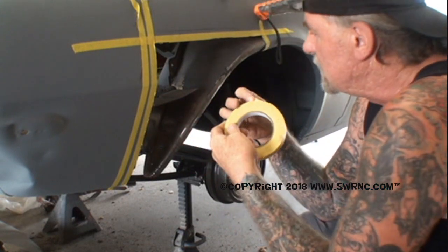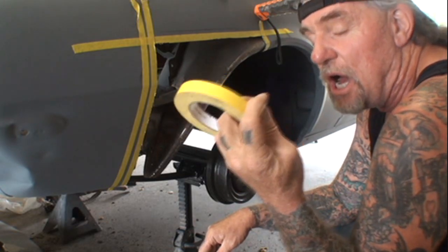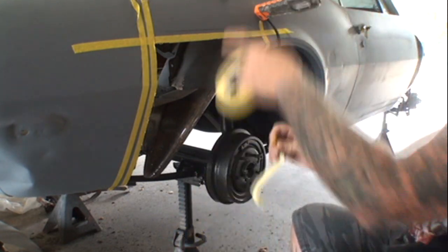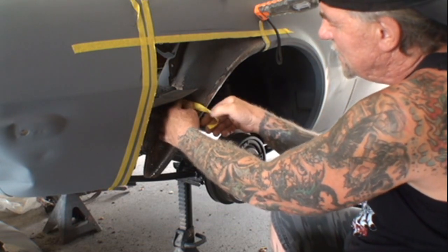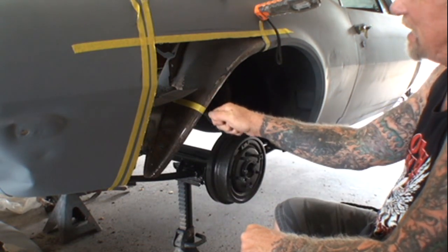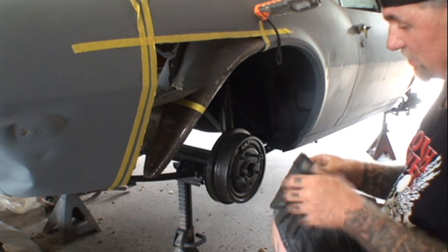I always like to use my bright yellow tape as a guideline — you see me do that a lot. Tape is a tool. Always keep a good automotive grade masking tape in your shop at all times. I keep three-quarter inch and one and a half inch. I'm going to use a piece of tape as a straight line because I can't see all the way in there. I want to make sure I come straight across and don't go around that curve at an angle, because when you wrap your tape around there you start going crooked instead of straight across. Always eyeball it out to make sure it's properly uniform.